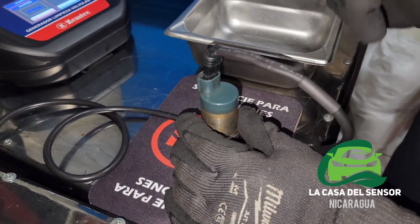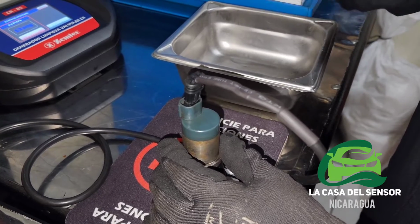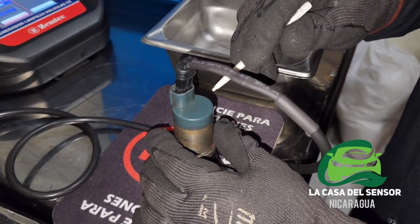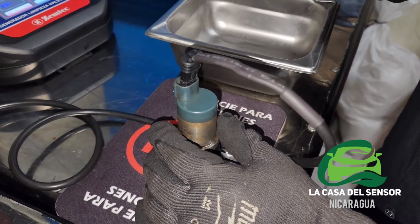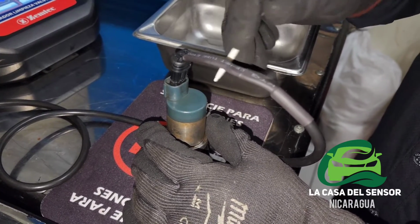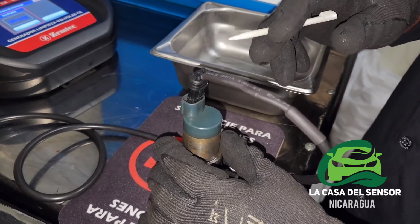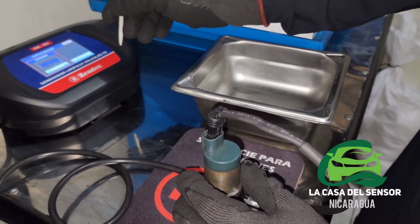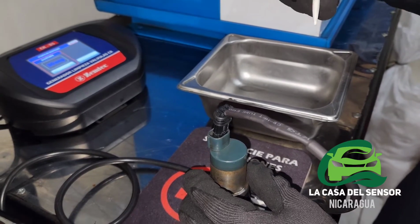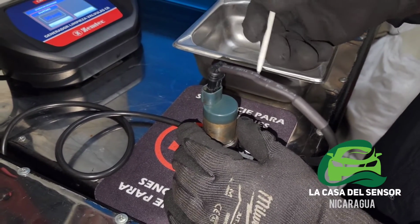Okay, we can hear a pulse much slower but stronger. It is a simple pulse, but it's a pulse that comes with a big amount of current, a lot of amperes. It's coming through the coil, the internal coil of the valve. Okay, 220 volts. This is the amount of voltage that you need to make this work. You can make it work with 110, but you will not have the full amount of current you need to make it work properly.